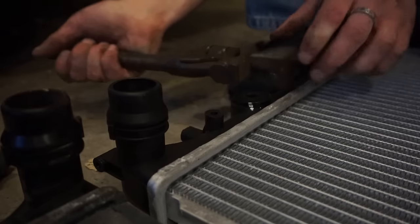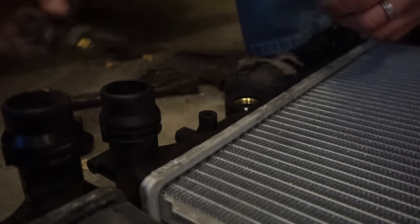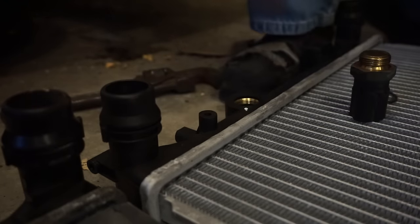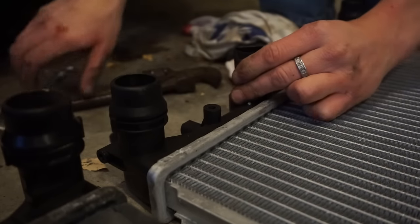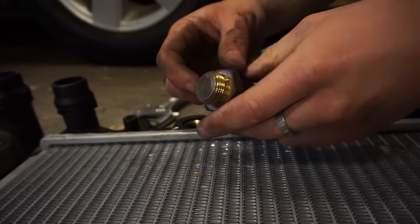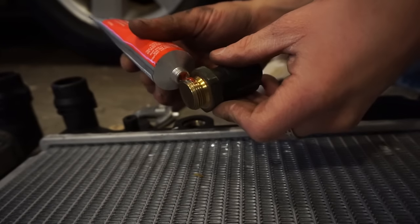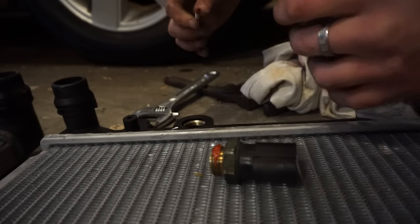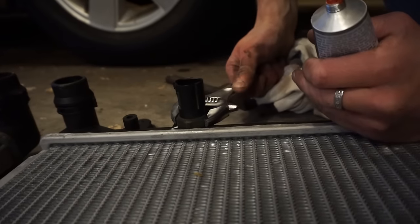Let's get the plug out of this one. Assuming we don't need thread lock, the cap has an o-ring - I'm going to transfer the o-ring from this into the thermostat. The o-ring's coming out - that's actually probably not gonna work with the o-ring in there. So I'm going to put a little bit of red RTV silicone on here - it's also probably not the right type, you're supposed to use blue, but whatever, it's just extra high temperature. It always dries back into the tube - it's stupid. Should be good enough. Now we gotta fish all the screws out of the coolant - tasty.